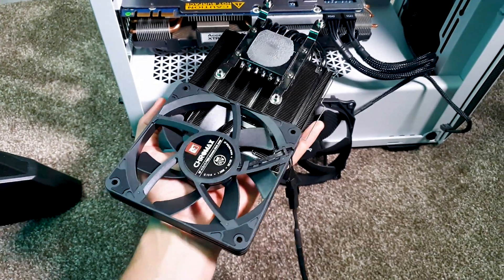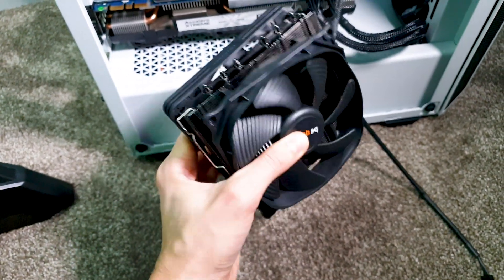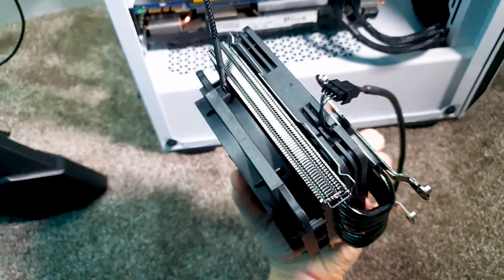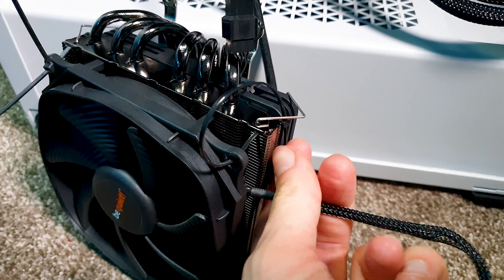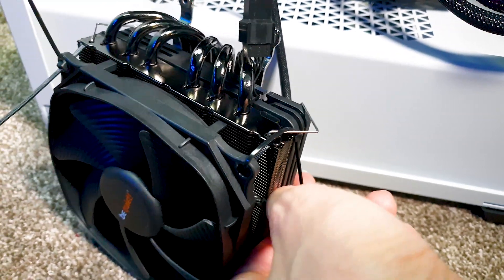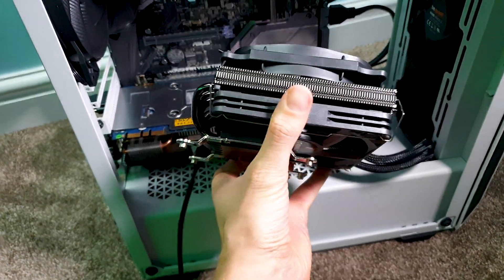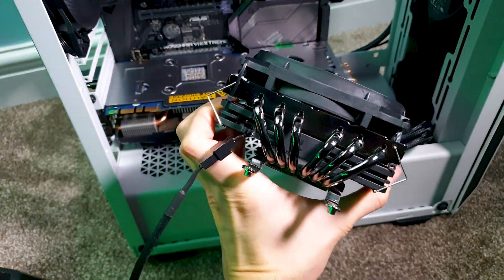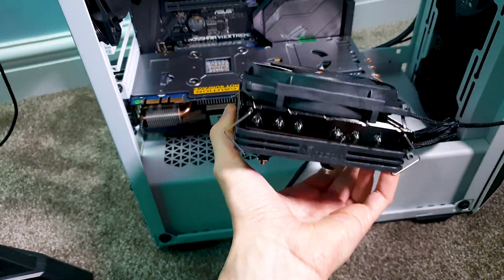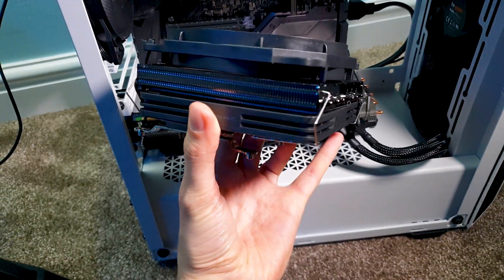Now let's move to the other option with the slim 120mm underneath, and on top you can basically put any fan you want. I'm using my Be Quiet fan from the Dark Rock Slim cooler. The Black Ridge comes with its own metal clips for either slim or regular thick fans, but my Be Quiet has a different frame so I just zip tied it to the heatsink. This is potentially the best fan combo for this heatsink — just don't forget about the VLP RAM for ITX boards. Here I just removed one RAM stick since it is an ATX board.